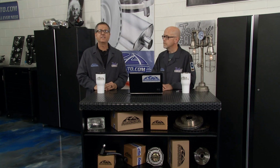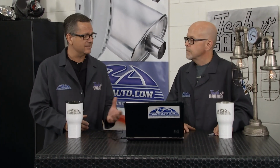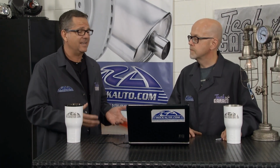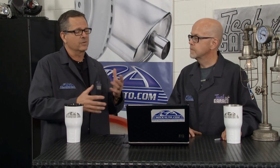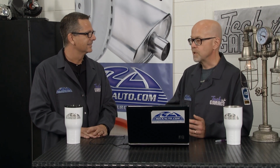Over at the table, we looked at a VVT, a variable valve timing solenoid. We looked at an ECT, an engine coolant temperature sensor, an injector, and a coil. Tom, whether it's an actual injector moving inside or it's just a coil with magnetic induction, parts don't last forever. And chains are only as strong as their weakest link. So you guys offer units for a whole assembly, don't you? Right. You wouldn't change your oil filter and not change your oil, or vice versa. If you've done a lot of disassembling, replace everything at once that might fail. If one part is worn out, then the parts surrounding it might be worn out.